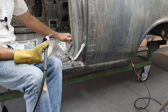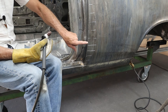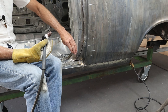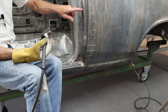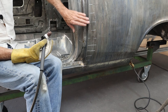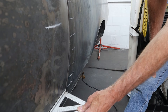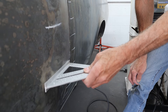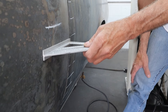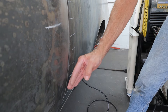Let's see if she stays. This opened up a little here, but we'll see if it fits down here and then keep doing that. If it's not far enough, we'll open the kerf some more. I really want to work from the bottom up since the gap is bigger down there — the panel will get slightly taller as we climb. Let's close the door and see how we did. Much better, but we're not there yet. It just slowly fades away as we go up — so we need to open that kerf up some more, pull it in tighter, and put a tack.